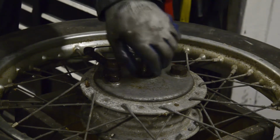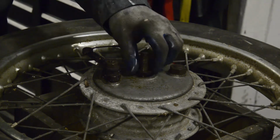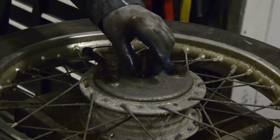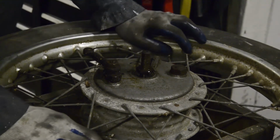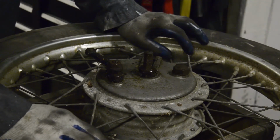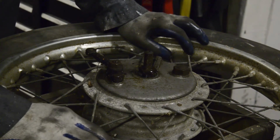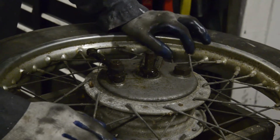And if you look at the comments, you'll see somebody from the UK, again, sorry, I can't remember names, mentioned some stuff that you can get in the UK. And it was also mentioned that you can make up, you can't actually buy it, it's got names again, begins with a K, Krull, crowd, something like that. A releasing fluid, which is basically a mixture, 50% acetone and 50% automatic transmission fluid. And I do have a bottle of it somewhere that I made up.